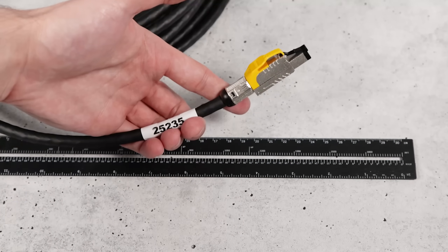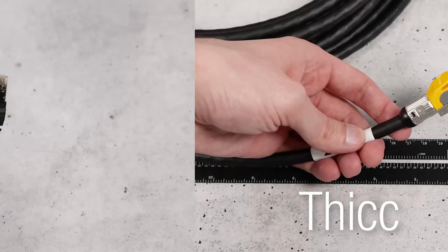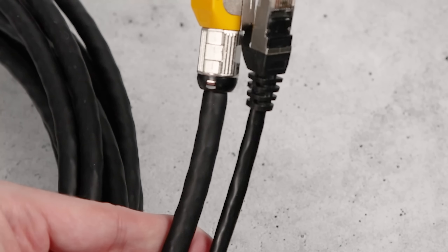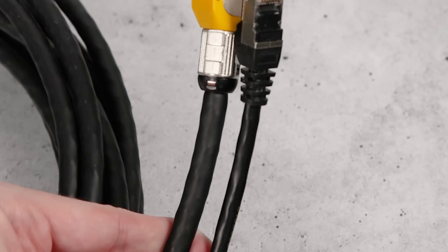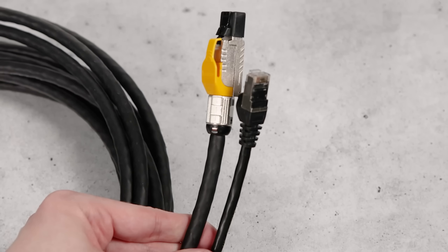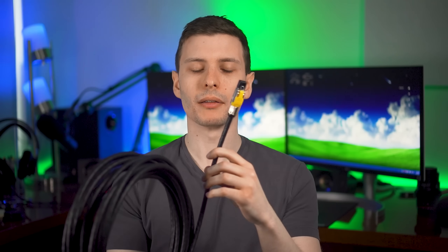In general, this cable is extremely thick. Compared to my old cable, it's ridiculously thicker. Part of that is the cable itself and the copper wiring, and the rest is probably extra shielding. It is not nearly as flexible as other Ethernet cables I have, but that's to be expected given the sheer thickness and the fact that it's solid copper. I don't want to mess with it too much, because if you bend a solid wire too much it has the potential to break internally, whereas stranded wire is much less likely to do that.